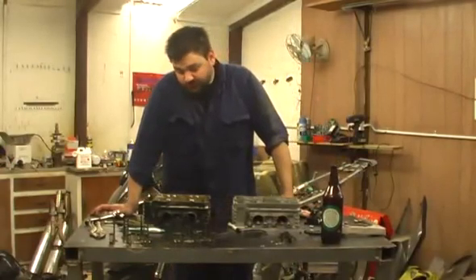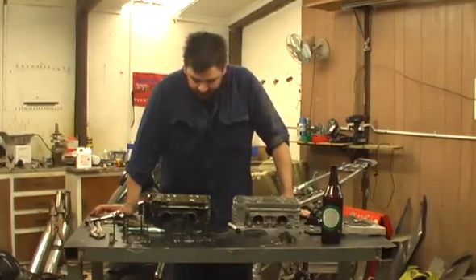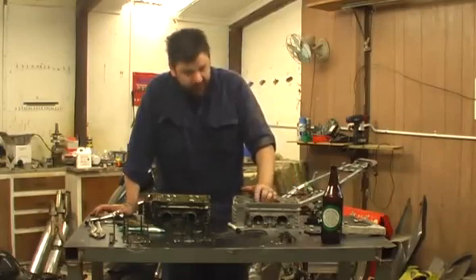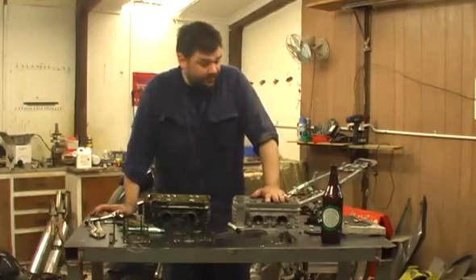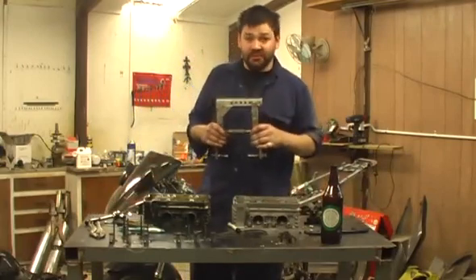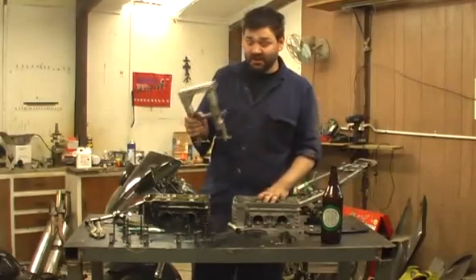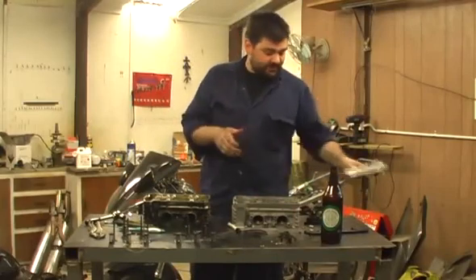Okay, all those valves are out — took about 25 to 30 minutes. Most of it's not too bad. I'll have to clean out these a little bit, get rid of some of the dust and dirt because those have been sitting there for a couple of months now. Get yourself a valve spring compressor — if not, make one. Took me about two hours using some scrap aluminium I had lying around. Nice and light, does the job.